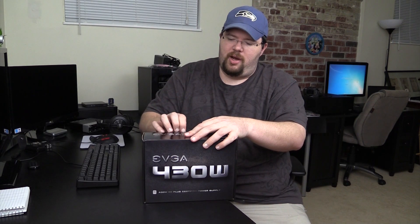Well, first off, at least 80 Plus — you don't want your electric bill to be a billion dollars. Frankly, anything less than 80 Plus is, we'll call it suspicious. So 80 Plus, 400 watts — if you're building a low-end system, it's not going to have a high-end graphics card in it, so 400 watts is going to be more than enough. In my opinion, you buy it from a reputable company. In this case, EVGA. There are a few others with $30-ish power supplies out there, but when you catch this guy on rebate — which every once in a while it is — you can get it for under $30, and that's a hell of a deal. So that's why I chose this.